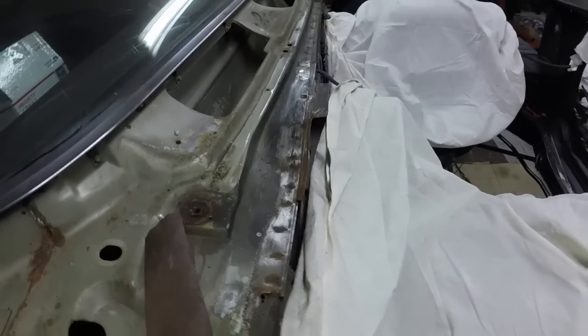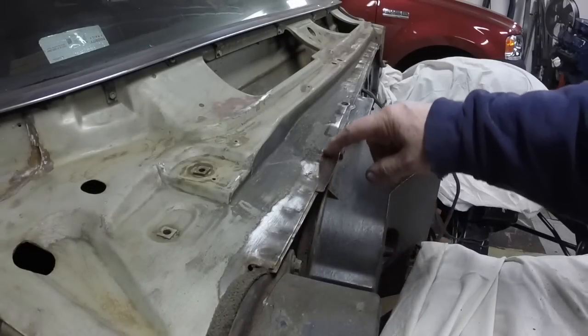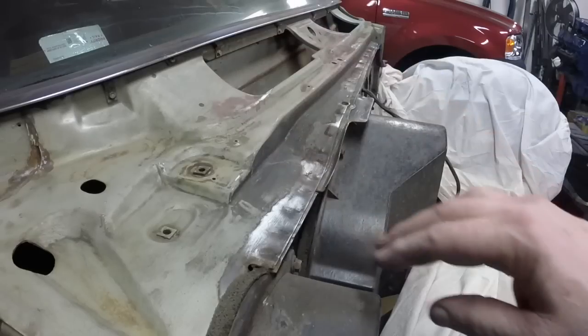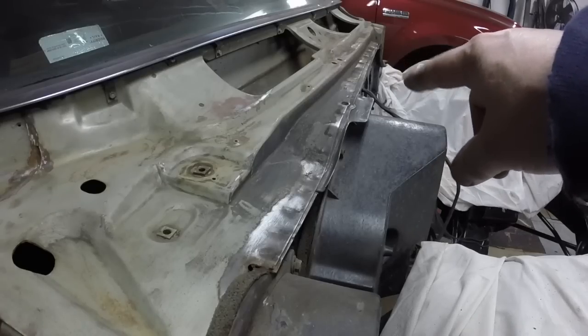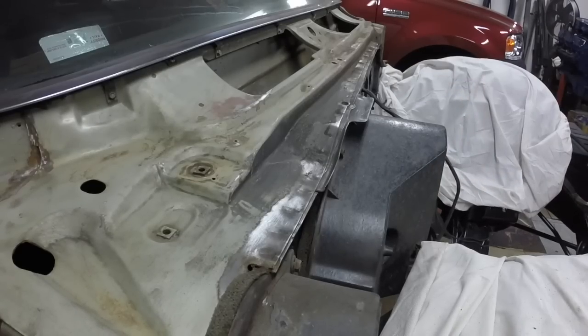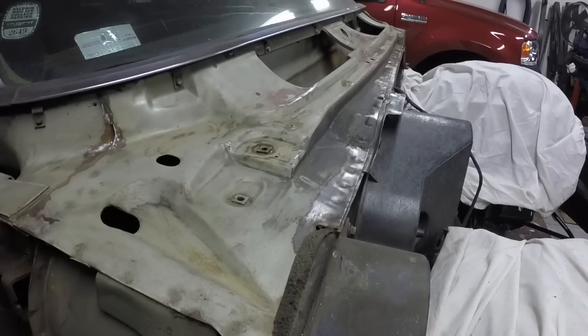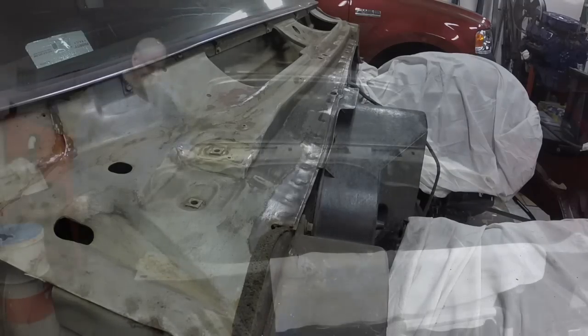I'll just work at it — I'm going to sand for maybe an hour then call it a day. I got most of the seam sealer area sanded out the full length across. I'll pull the molding off tomorrow. I still got a little more to do, and I need to sand some more over in that area on the other side, then give it a quick sand in here and it's ready to prime. I'll let the primer dry 24 hours, then seal all the seams, and then blow some paint on it after another 24 hours of drying.